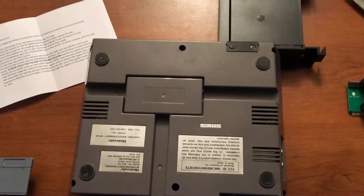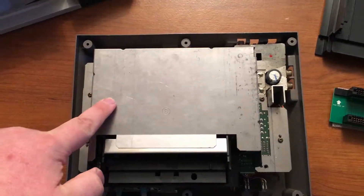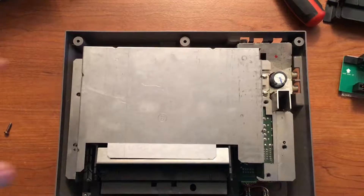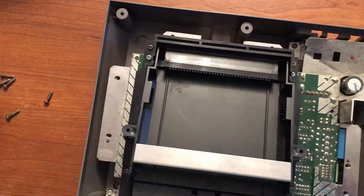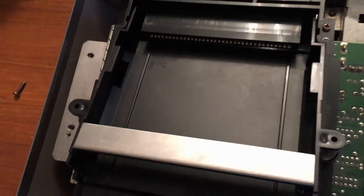There are six screws in total to take out of your Nintendo — one here, back here, in the middle, and then over on each side. Once you get those six screws out, take the top off and you have your RF shield. There are seven screws to take off the RF shield. Once those are off, you can take the shield off and you're down to the tray. See how it is slanted? That is where they say a lot of the issues come — because you slide it down and when you push it down it straightens out, but the pins get caught, bent, and twisted going down at that angle.